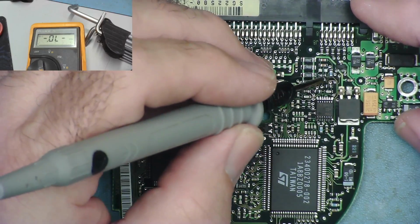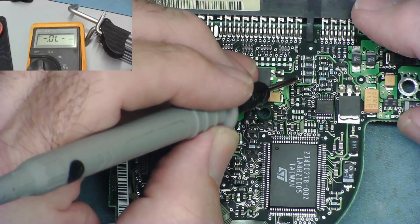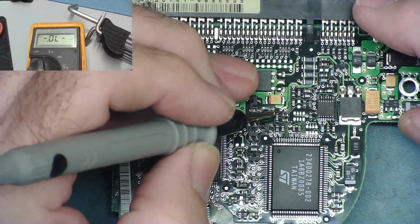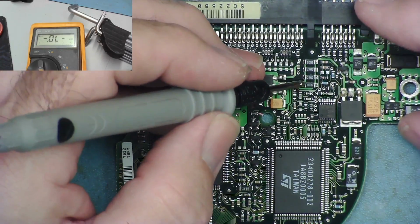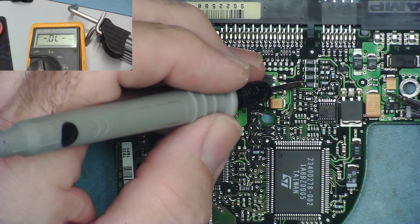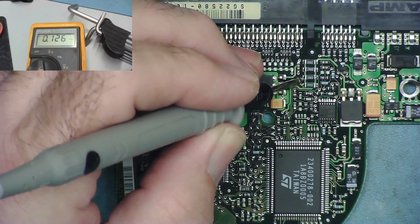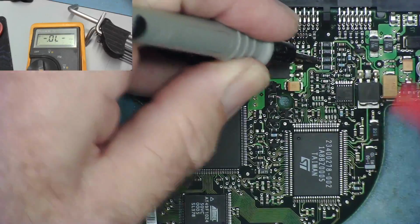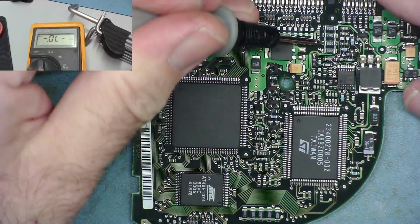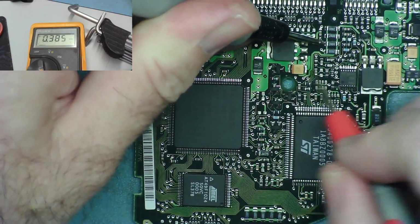But we have that. Now, this also goes to here, and if you look, this is like a row of low value resistors, 2 ohm, I think. 2.2 ohms in parallel gives like half an ohm. And that comes from over this way somewhere, yeah. So those look like, oh, they might be current sense resistors. I mean, it's possible this end is ground. If these are current sense resistors, maybe the other end connects to where the motor goes or something, I'm not sure. Where's the end of these resistors go to? Well, it effectively goes to ground, so it's going to read like ground anyway.